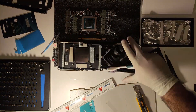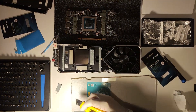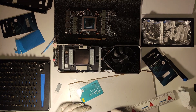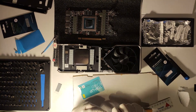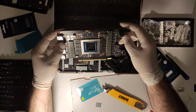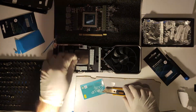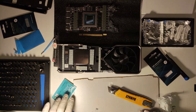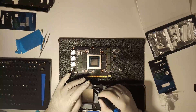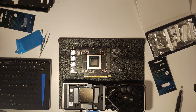Do not use scissors — you'll destroy the thermal pads. I found it easiest to apply them to the cooler directly as the card will come right on top. This whole part should use most of your first 2mm Gelid Extreme thermal pad. Take your time and remember no one is chasing you. Not making mistakes means you don't waste your surprisingly expensive thermal pad or, worse, delay the reassembly until replacement orders come through.